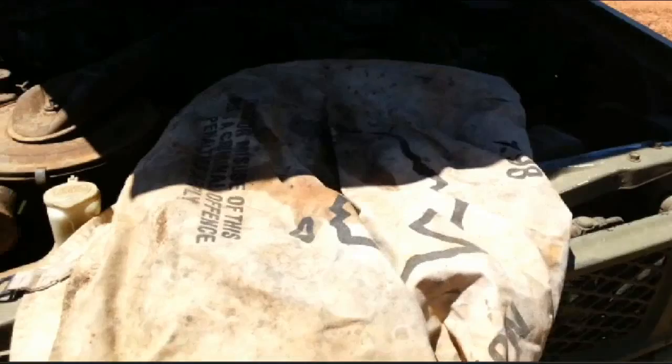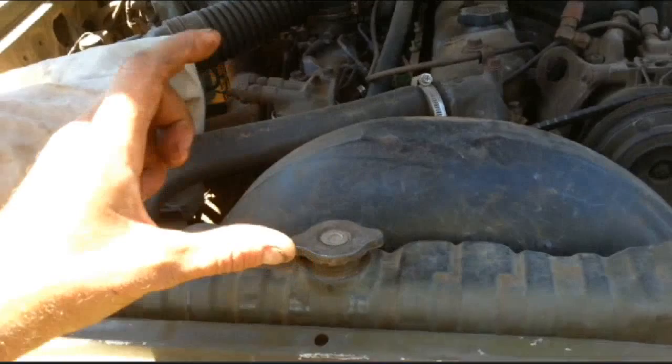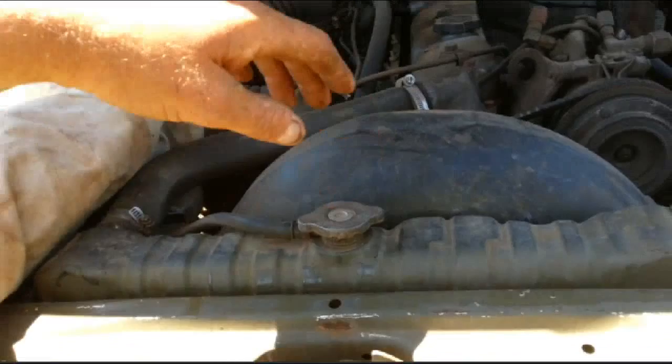I'll give you a good hint guys for radiator leaks — if you've ever got any tiny leaks in your radiator, get a little container of ground black pepper or normal white pepper, open up the container, and empty the whole container in with the pepper. That will block up any holes in the radiator.